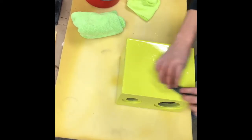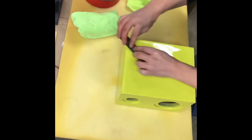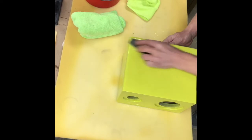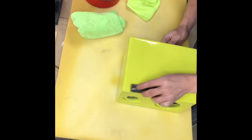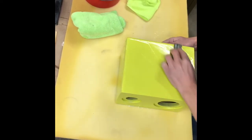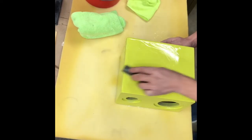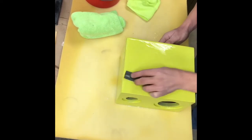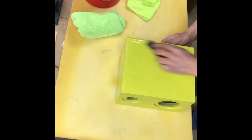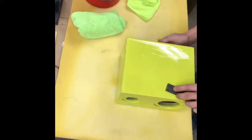And we're not pressing. If you're gonna press, you might as well just use a lower grit. Just sliding it across. Being careful of the edges, you don't want to flop over those. Hopefully I'm in the right light here so you can kind of see some shine going across here. That way you've seen the orange peel when we started.